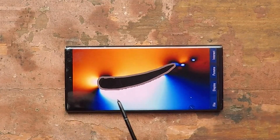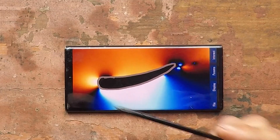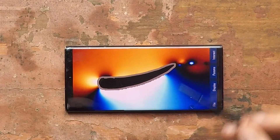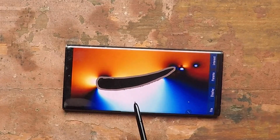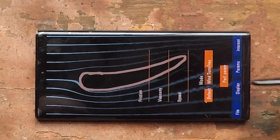The blue and white areas are low pressure zones — everything orange and red is much higher pressure. Look how clearly that displays what I've been talking about: we get a low pressure zone underneath the wing because that's the much faster-moving airflow. You can very clearly see that if this area is really low pressure and above it is much higher or ambient pressure, the higher pressure wants to push down towards the low pressure zone — and that is exactly what gives us our downforce. It's a really nice way of displaying it in very simple terms, and it's a really visual, graphical way of highlighting everything I keep talking about.